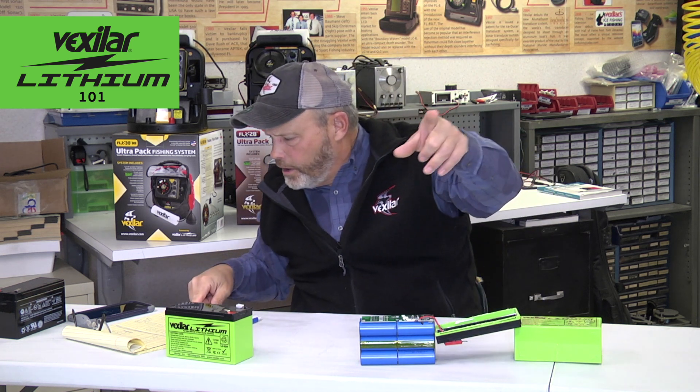You would not use this type of lithium battery for an electric drill — you would use a different blend. Cars use a special cobalt oxide with manganese aluminum oxide blend. They come up with all these fancy oxides that make electrons function even in cold weather environments. But we don't need that because we don't draw heavy energy in cold weather environments. So it's cost effective.